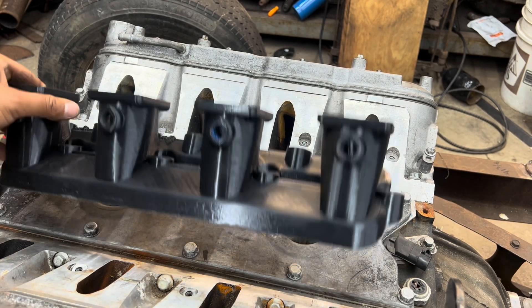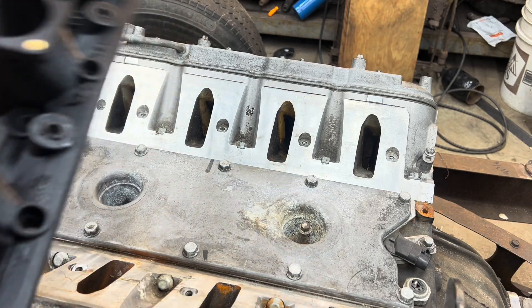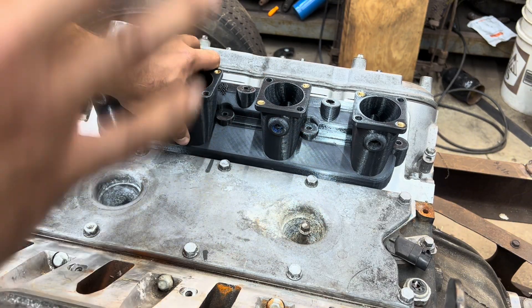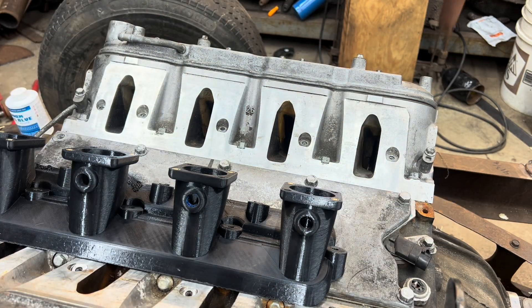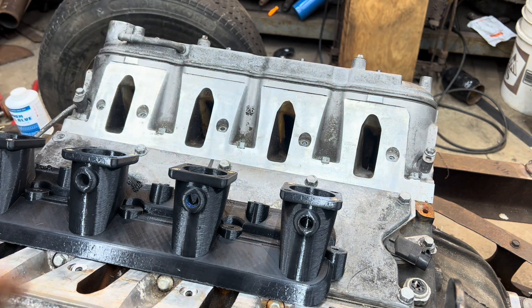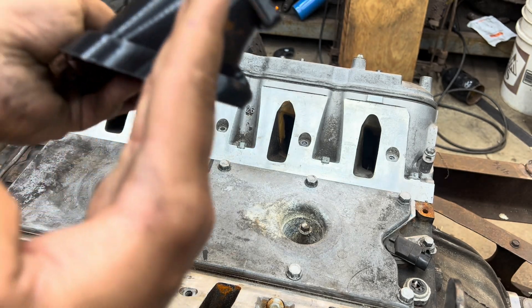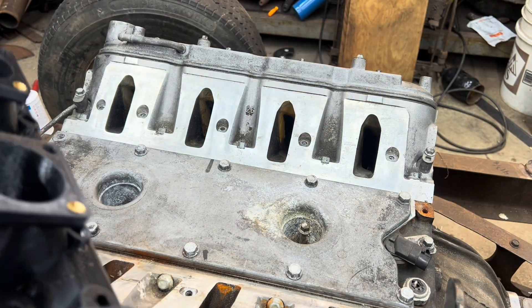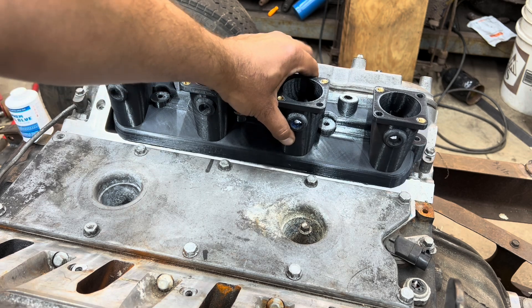If you're familiar with the LS platform, or the way intakes mount to the head — because it's a V8, the valley and the angle of the intake mounting surface is at an angle, but the bolt locations are flat. The bolts go straight down as opposed to going straight into the head. So it posed some challenges when designing in CAD. When I was designing the angle of these ports, I had it 90 degrees to the bottom and then had to angle it so it would mount straight in, and my axis point where I did that adjustment was incorrect. So my bolt holes are a little bit too far down.